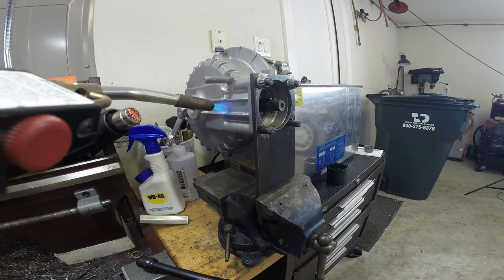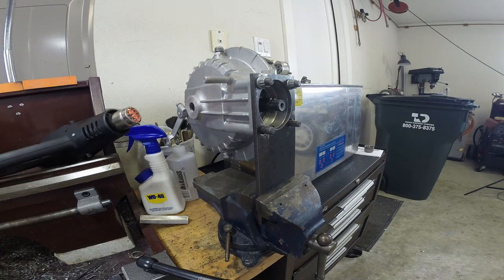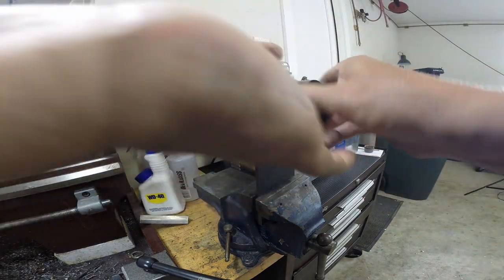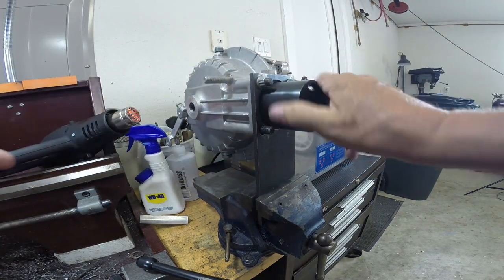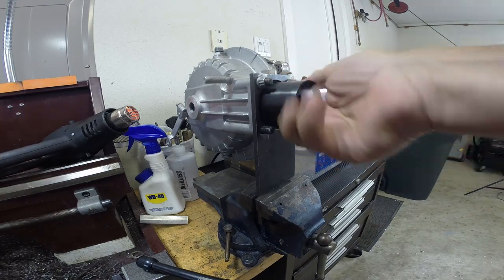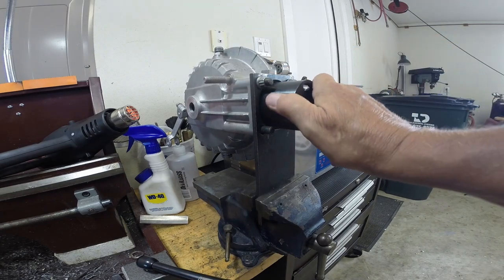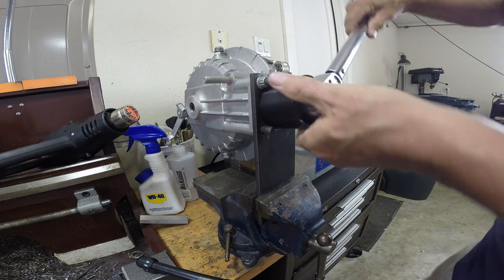With all the metal in there plus the big metal piece holding it in the vise, it takes a long time. You heat the final drive housing, put the threaded ring in the freezer, and then use this special four-point tool. I got this tool from Boxer Two Valve — Euromoto has them also — and you put it in there and torque it.